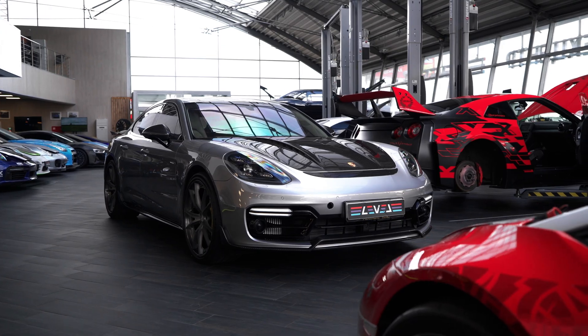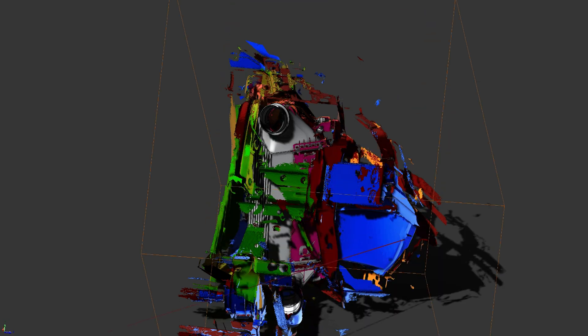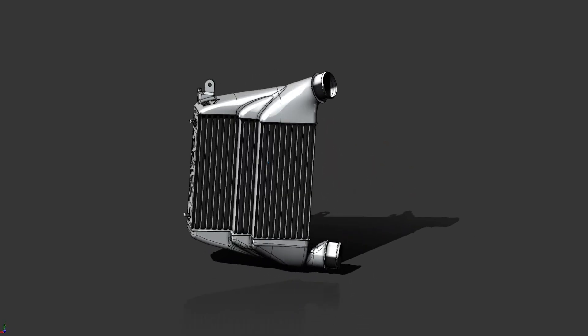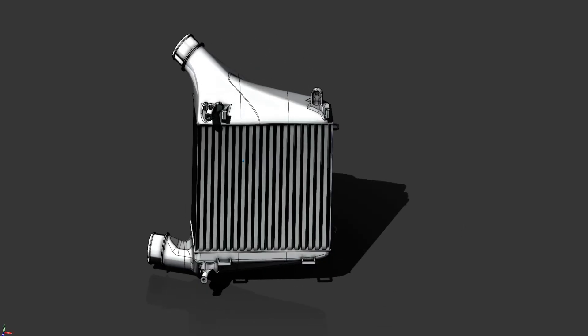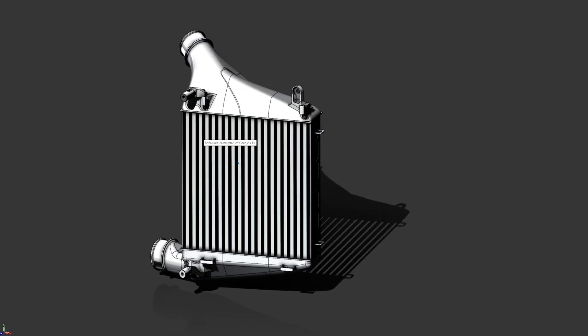We've scanned a Porsche Panamera in order to design a set of intercoolers, and on this image we can clearly see how tight the packaging is. The front air duct is really tiny — we don't want to remove it, so we can't move forward, and there's no wiggle room behind it because of the wheel arch. We'll fill up the empty space with a step-like core, print the tanks, custom order the core, and preserve all of the factory brackets and mounting points.